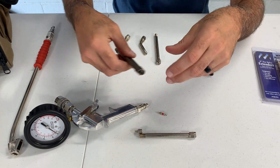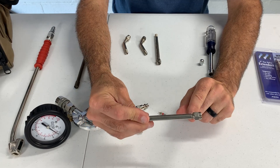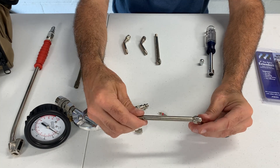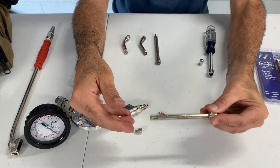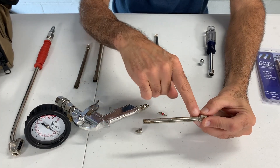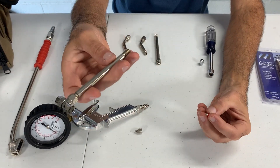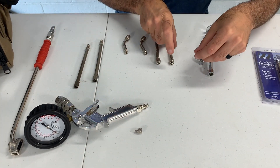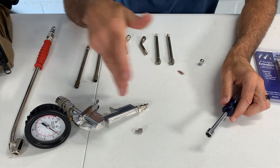But what I ended up doing was creating a new problem — and that was this swivel point. With my small tires, my RV, and my application, it was just too much for this valve stem. The constant bouncing, the suspension, everything — it failed right here at the edge. So basically what did I do to fix that? I had to come up with a solution, and that solution was to get rid of the valve stems completely. I'm not running these on my RV.